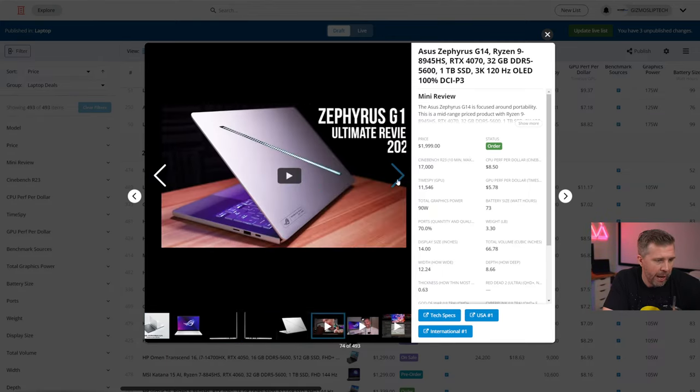I don't know. Yeah, I think it's largely because it's Ryzen. It's a little bit more power efficient architecture, but I think it's also a matter of how the firmware and the BIOS prioritize CPU, GPU power allocation. Could the Intel CPU right here actually go down to at least under 20? And then we could go to 75 up here for the GPU and the same total wattage going through the system. You might be able to have significant power boost gains overall if the GPU could boost higher right here.